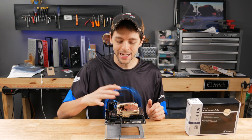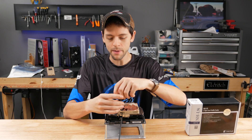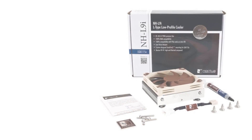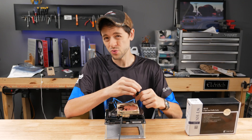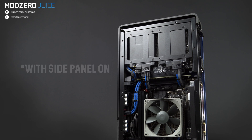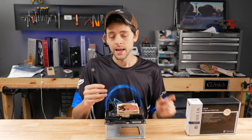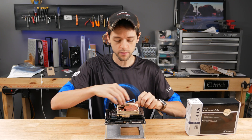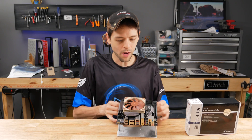Now that you have the proper orientation of this cooler, let's do something about this wire. You can actually remove the fan quite easily by unscrewing the top four screws. Noctua also provides a set of longer screws if you want to replace this fan with a thicker 25mm version, which would not make it compatible with the S4 Mini. Now we can rotate the fan 90 degrees so the cable is pointing towards the PCIe 16X slot. The best thing to do is to wrap it behind this heatsink right here — there's a channel that's almost exactly the same size as the cable. And voila! Super clean, neat installation without your cable flopping around.